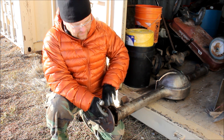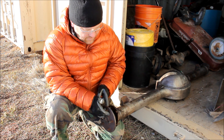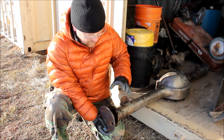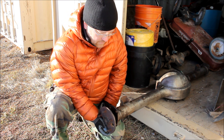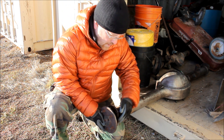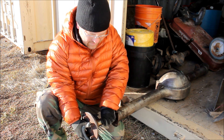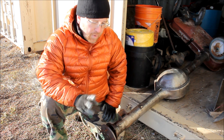You then insert it into the housing. The problem with a semi-float rear is this axle has to handle rotational force, but it also has to support the weight of the vehicle through this bearing. So all of the weight of the vehicle and cargo is on a single bearing, pressing down on this axle. This axle has to handle rotational force to move the vehicle forward, and it also has to handle the weight of the vehicle — this axle is being bent and twisted at the same time.